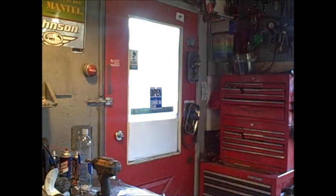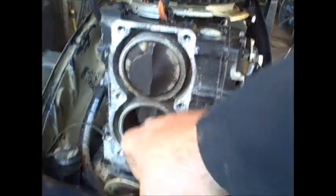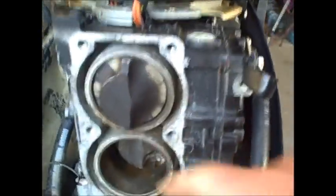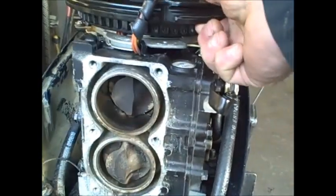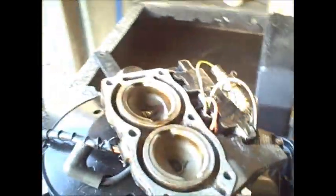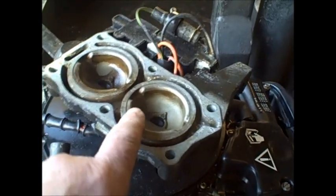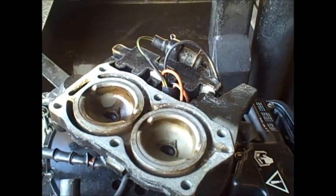Okay, continuing on with this little 15 — I'm going to show you what I got. I pulled the head off and I'll give you a look and see what we got. When I pulled the head off, I could tell there was a little of that brown yuck in that lower cylinder — hopefully you can see that there. But also, if you look at the head, you can see in the top cylinder there's some black staining. And the bottom cylinder looks like it's been almost steam cleaned, which is a good indication that it was getting water in that lower cylinder.